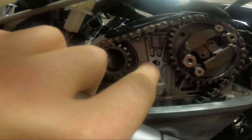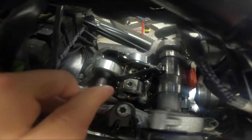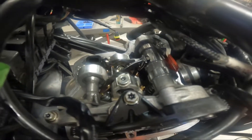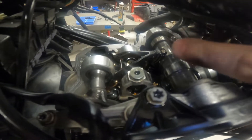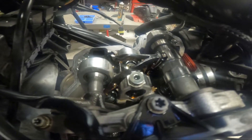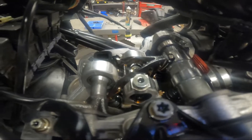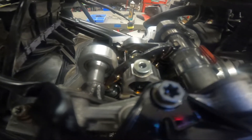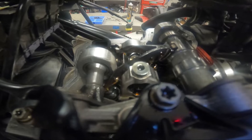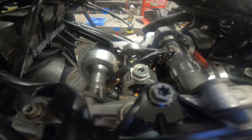You do that by sticking a six millimeter bolt through this hole — it will thread into that rocker arm shaft. You need a pretty long bolt, so I just used a piece of M6 all-thread I had laying around. Once you have those bolts out and you're threaded into the rocker arm shaft, you'll be able to nudge it and pull it. Sometimes you have to turn the motor over with a 13mm to take a little of that decomp pressure off the rocker arm. Once that pressure is off, the rocker arm shaft slides back just far enough to let you pull the rocker arm out.